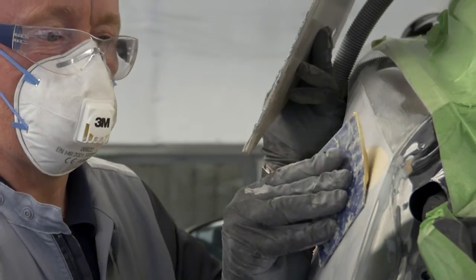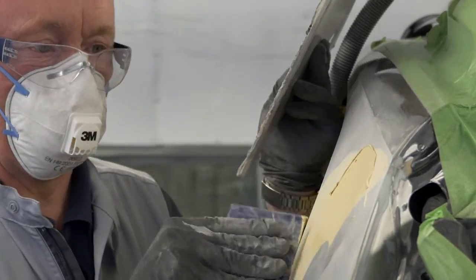Finally, let's talk about how we can fix pinholes. One easy way is to mix and apply a fine polyester body filler or glaze over the polyester repair to help fill in any pinholes, then sand smooth after the glaze is dry.